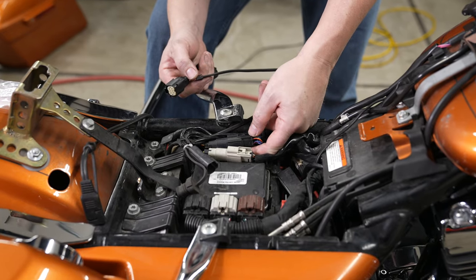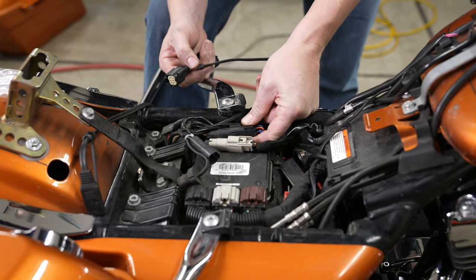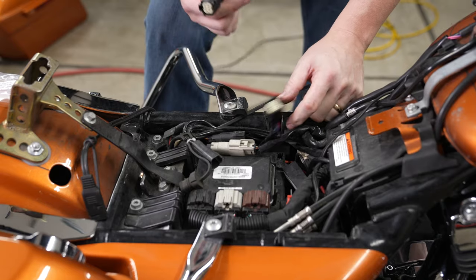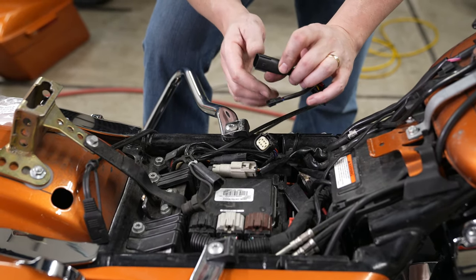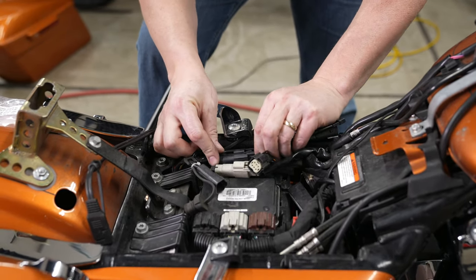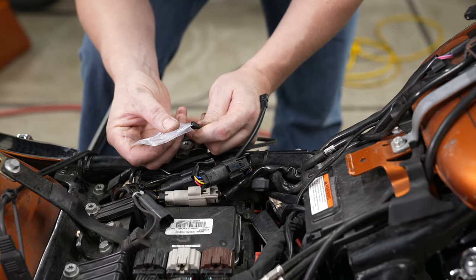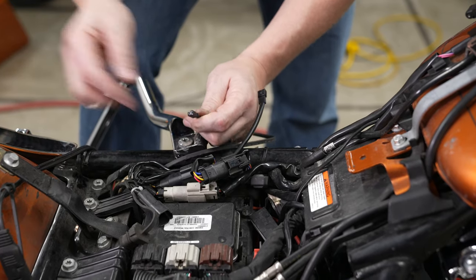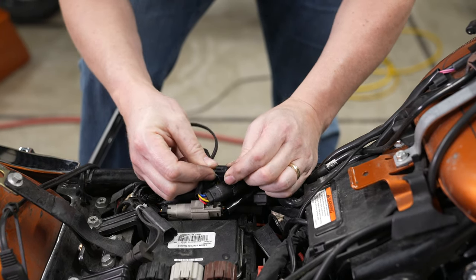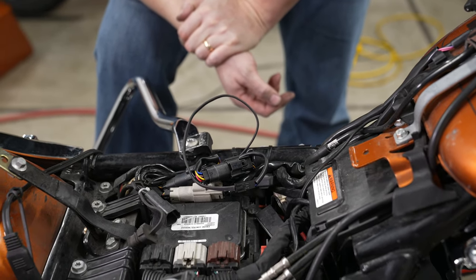Under the seat, you've got a gray plug and a black plug. The black plug is your brake line, so you're going to split it — push and pull to disconnect it. In his other hand is the splitter from the Ciro 3D Crown light, and he's going to put that in between — it only goes one way. Then the other side of the stock line goes on. Included in your kit is a little dielectric grease — put that in the Crown Taillight plug, then the other side of the splitter clicks together. Wire management is obviously up to you on how you button everything down.